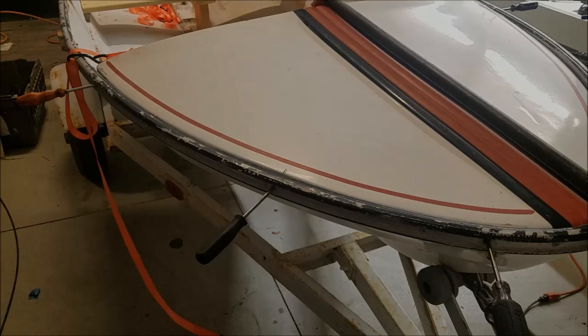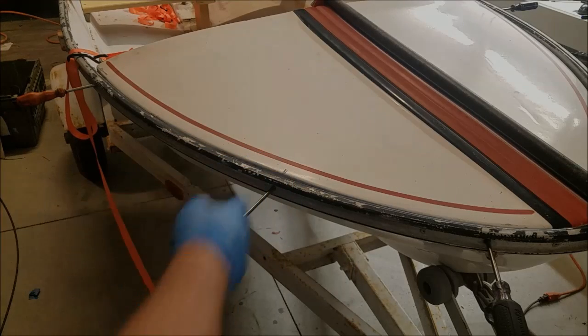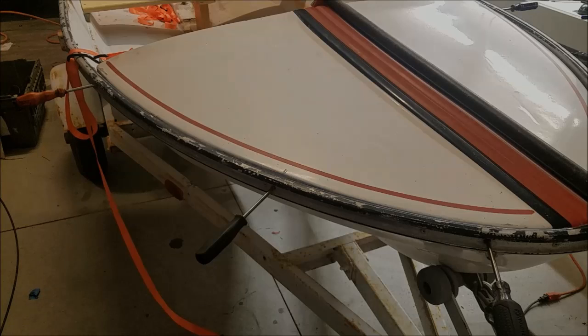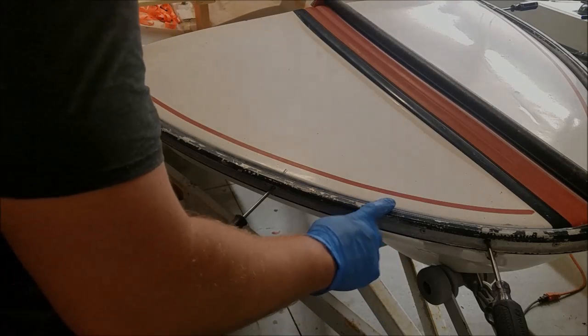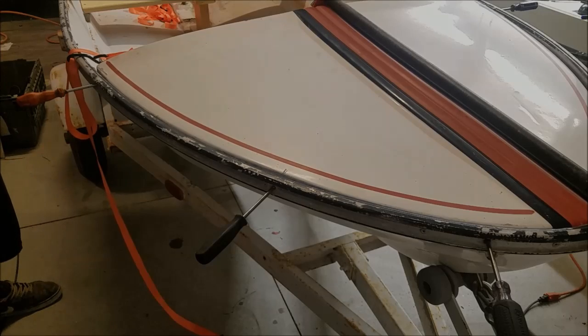Alright, it's kind of looking like Hellraiser here, but whatever. So what I did was jammed a bunch of screwdrivers through the old alignment holes where this thing used to bolt on. That kind of aligned the cap where I think it's supposed to go. And then I used that pipe clamp to suck it in forward. Now what I'll probably do is still raise it up more, but I'm going to start getting the back bolts in, kind of work my way around.